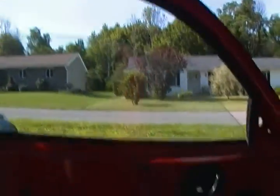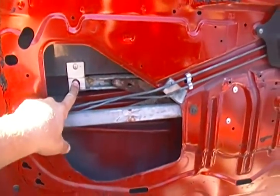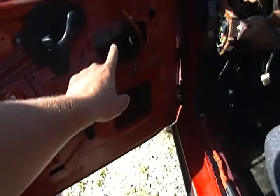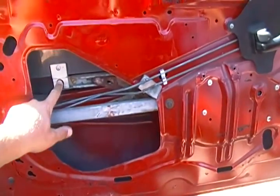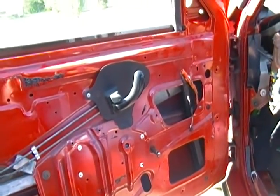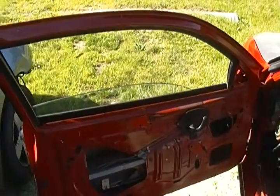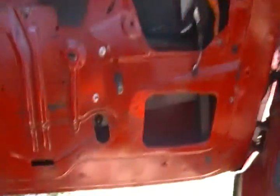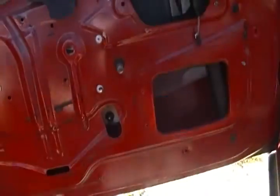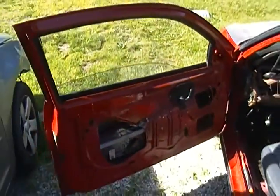See how I've wound it about halfway down just using the old crank — this one was power. On this Cavalier you just have these bolts. There's one here, and there's one just inside here on the window, which kind of stinks because it's just a 10 millimeter. I'm gonna use our socket to take this off and then pull the handle off to get to it. Simple process to get the door windows out. Lower the window almost all the way down — the manufacturers left an opening there. Just need an extension to get in with our socket, then pull the window up and slightly at an angle and she'll pull right out.